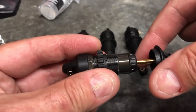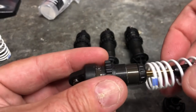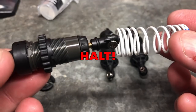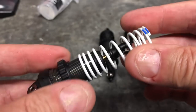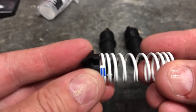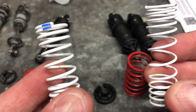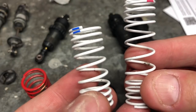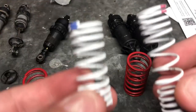Fitting new shocks and springs may seem simple with just two screws to attach to the car, but when fitting new springs you need to remove the end cap first. I've got my four shocks ready to go, but there is one slight problem — it appears the GTR shocks are slightly wider than the existing ones. The stock springs will not fit, nor will they fit over the end cap. No amount of wiggling is going to make them sit properly. The rear XX-long shock is also substantially different in size, so I'm definitely going to need new springs.